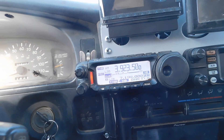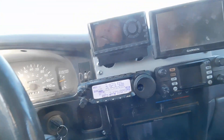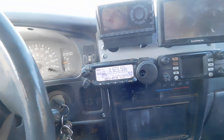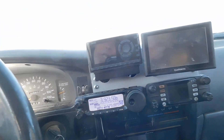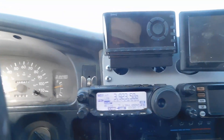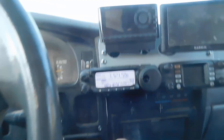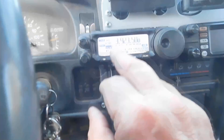That's how the tuner works. But what I'm getting at is this tuner does not work with the 102-inch whip on 80 meters. It also does not work well on 20 meters — I've read a lot of people have problems on 20 meters. I'll put it back on that antenna — you can hear it dropped out — but I could try to tune it; it's just not going to work.